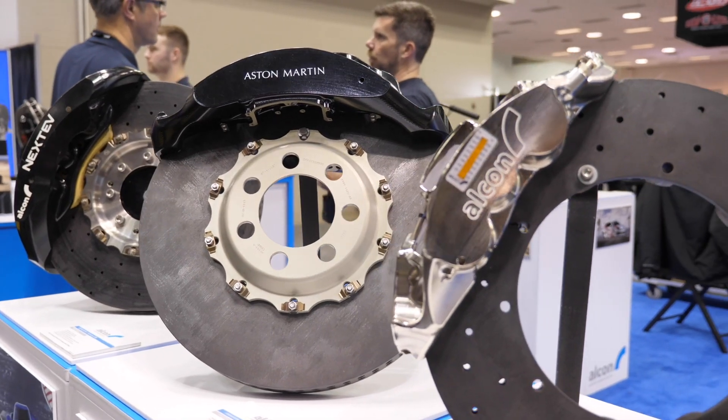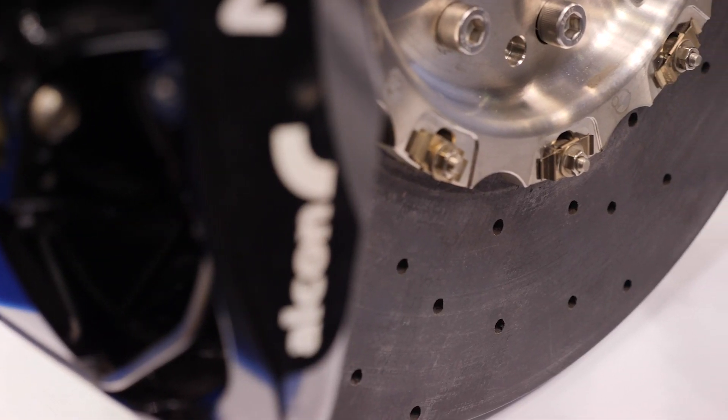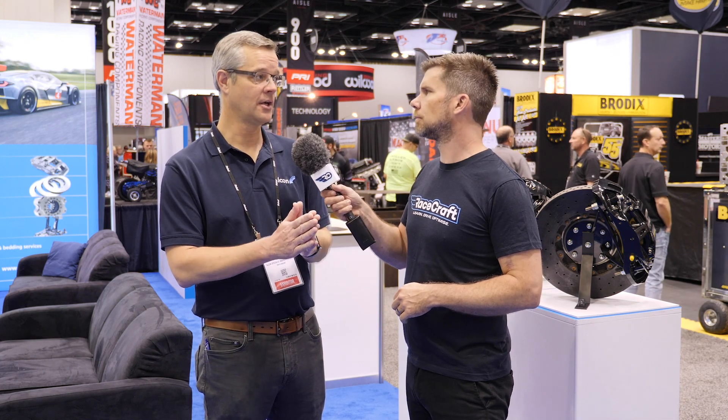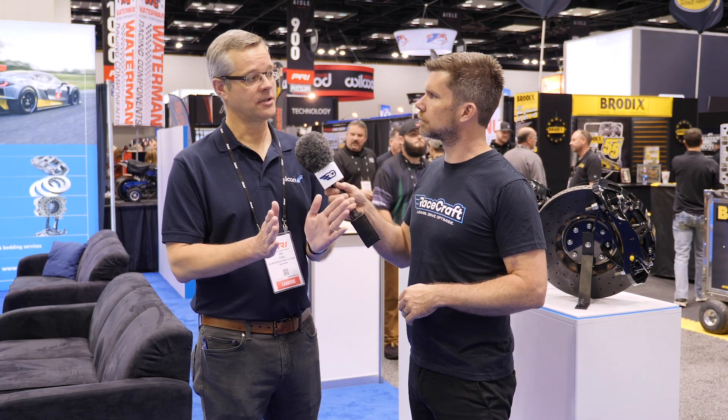With four or six piston calipers, sometimes the individual pistons are all the same size and other times the piston sizes are staggered or differential sizes. Racing pads and high performance pads have a natural tendency to taper wear for a number of reasons — there are mechanical reasons where the leading edge of the pad tends to wear more, characteristic of the material itself, and there's also pad migration where material moves from one end of the pad to the other. The staggered pistons help to counteract that. Typically you'll have a much larger piston on the trailing end of the caliper to toe the pad in at the back end to keep everything flat, giving you longer pad life, better pedal feel, and just a better solution all round.